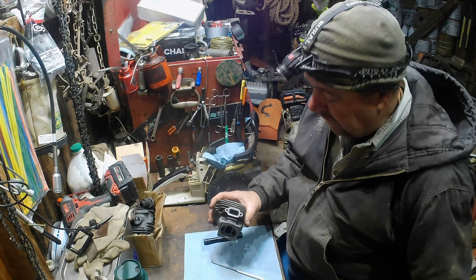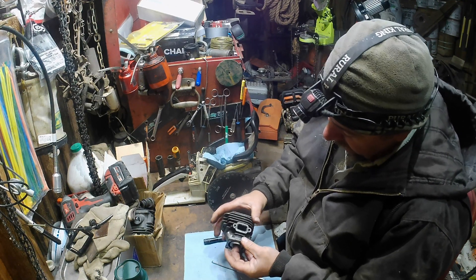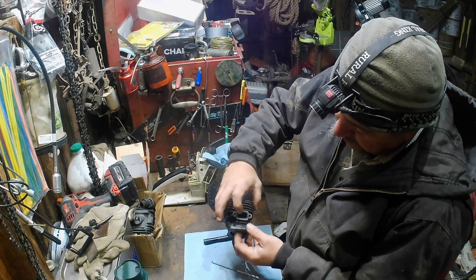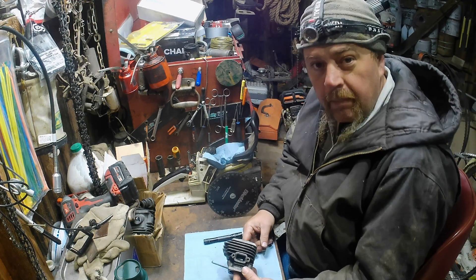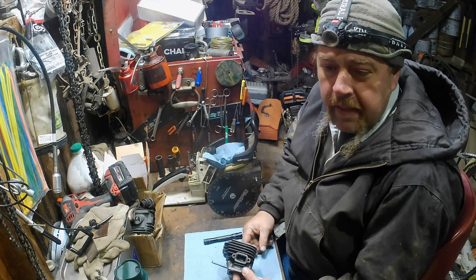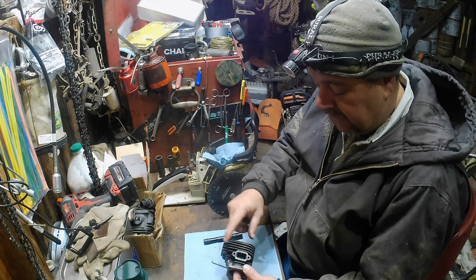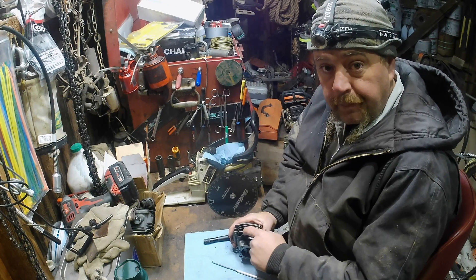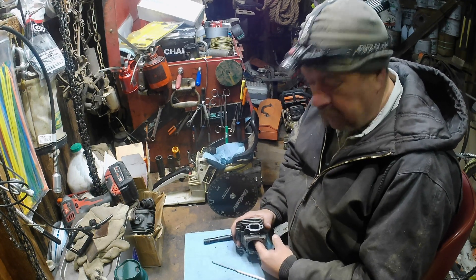Conversely, if that air is running in there so fast — like sheep or Three Stooges or dogs bouncing back in the door — you could be at 1.05 atmosphere just as soon as that closes. That's going to give you more compression. The lift is going to more affect your dynamic compression. Think about that like a cam — if you can raise your dynamic compression, that's pretty much free, I just have to keep opening it up until I go too far.